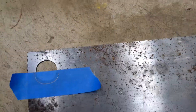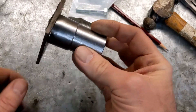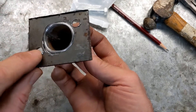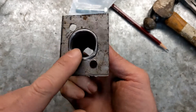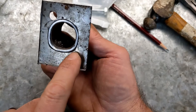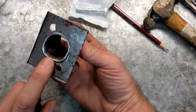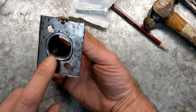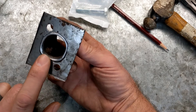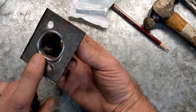This next part is just going to be me opening up this hole enough to snugly fit the flange I've made into it — I'm going to be using this big die grinder right here, and I'm not going to record this because it is mostly just super loud. Here's the rough piece — I've got the flange roughed out, holes drilled. I've got a pretty good fit here; it's a little more open than I would have liked in one spot. I was thinking about fillet brazing — except for that one spot I've got a nice tight gap. If the brazing melts, I've got bigger problems than this exhaust manifold coming apart.